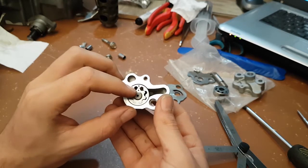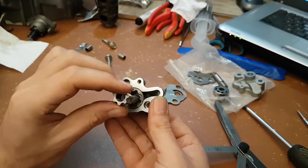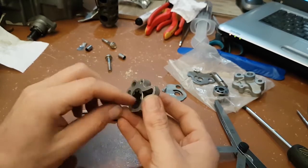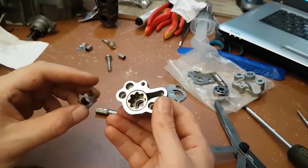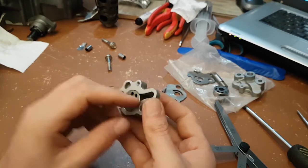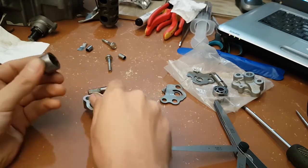That's the reason for these dots — so if you installed in this direction, keep it that way when putting back together. Same for the rotor: if you realize your outer rotor was installed one way but the inner rotor is the other way, just keep things that way. You will at least not add more damage to the surfaces.